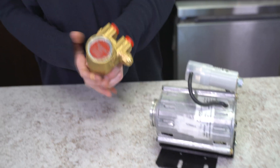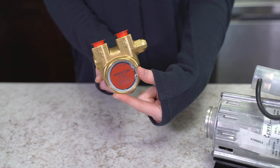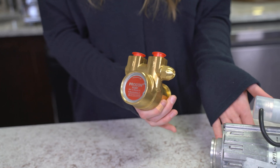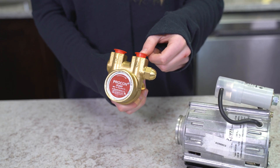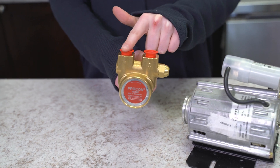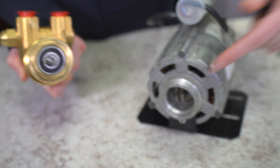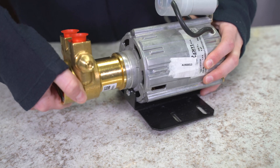We're talking about 100 to 300 espressos or coffees. So let's have a look at this pump. We have our input, we have our output. This piece right here in the middle, on the inside, is similar to a water wheel — like a water wheel on a mill. So when you attach this to your motor and you turn the motor on, the water is going to enter through the input here, cycle through this water wheel, and come out through the output up top. This piece right here — see that? That's going to attach right in there, right into the motor.